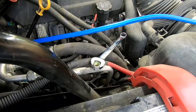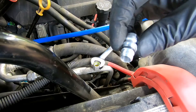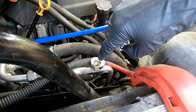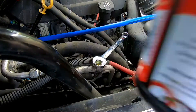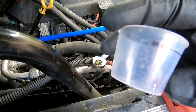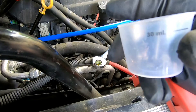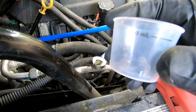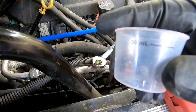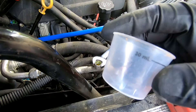We got our new one in here. Now, before we go putting this one back on there, we're going to go ahead and pour in our 3 ounces of PAG oil. We got our PAG oil and a medicine cup which measures 30 milliliters, so that's roughly about 1 ounce. We're going to add 3 of these to the system, because that's what I found for replacing the accumulator — they say to add about 3 ounces of fluid. Let me know if you guys do anything different.